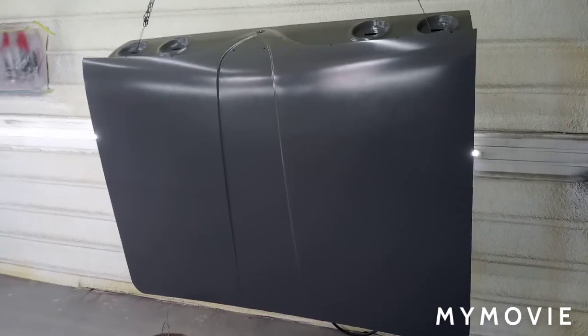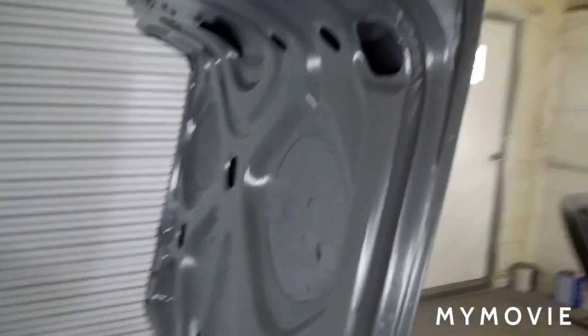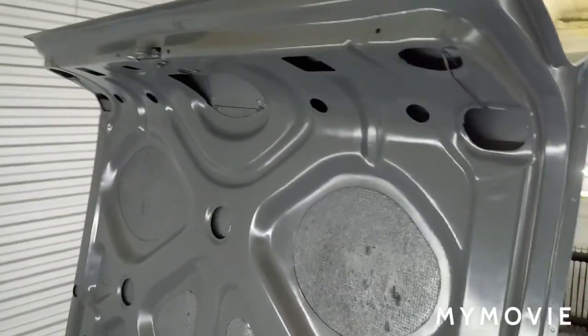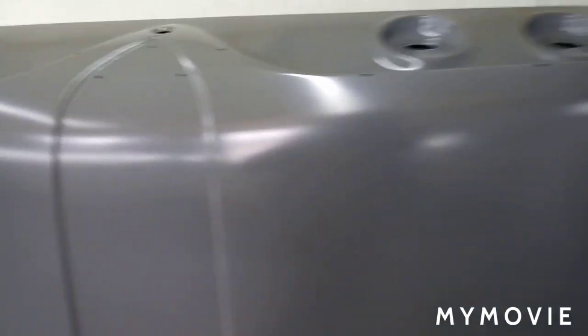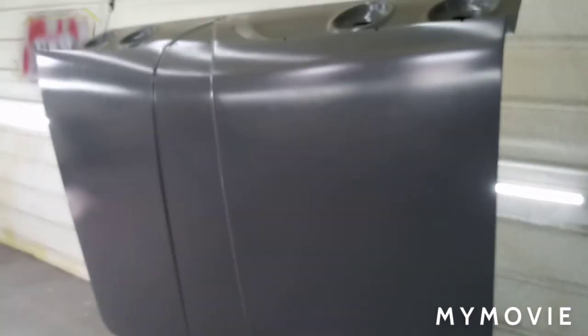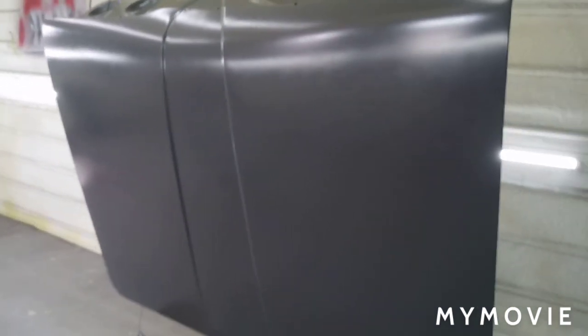Alright, here we are about an hour later. I got the top side in 3 coats and the bottom side in 2 coats. And man, honestly, this thing covered in 1 coat. Still left a little bit of 400 scratches. By 2 coats, it was a done deal, but I went ahead and put a 3rd one because this area right here is kind of tricky, and since it's hanging up, I have to use a stool. So just kind of an insurance coat. I sprayed this with the Iwata LPH 400 orange cap at 16 psi at the inlet, which I believe turns into 10 on the nozzle.